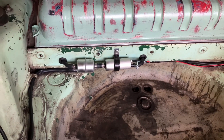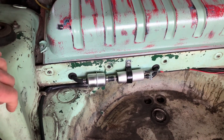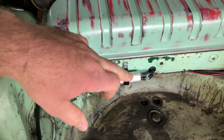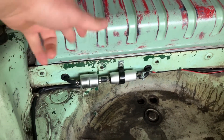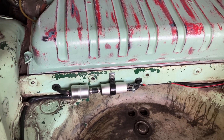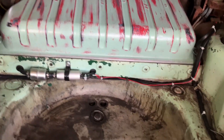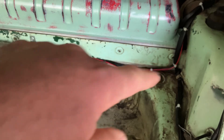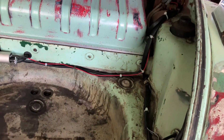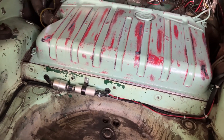I got the fuel pump mounted there, lined from the bottom of the tank. Comes here to the filter, pulled through the pump, down under the car to connect to the stock fuel line that runs through the channel — that's still there. And I've got the pump wired, running through the little clips that are built in for the wiring harness, up to a switch on the dash so I can turn it on and off.